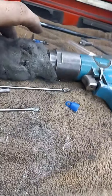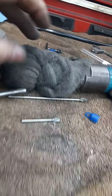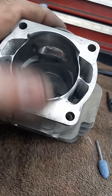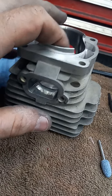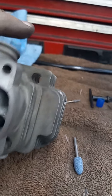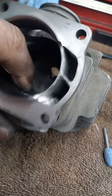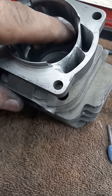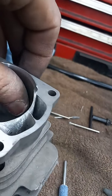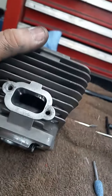I get asked periodically what I clean up the cylinders with — it's just an air drill with a wire brush that I stick the gray scuffy pads on, or red ones. I like the grays in the cylinder. They work good — that wire brush acts like a piece of velcro, you just stick it on there. I run them down dry but I feel it does a better job than the little ball hones. It falls right into the ports. I'll still use sandpaper, and I got round stones that I go in and put a chamfer back in, then go over it with sandpaper.